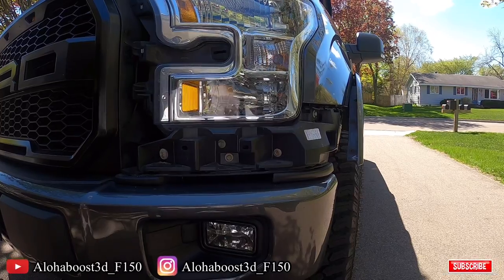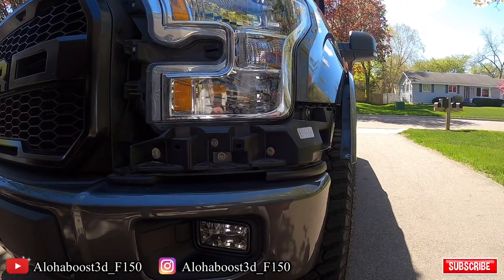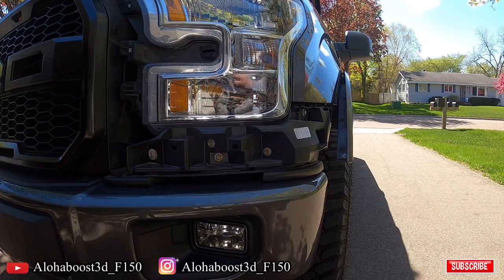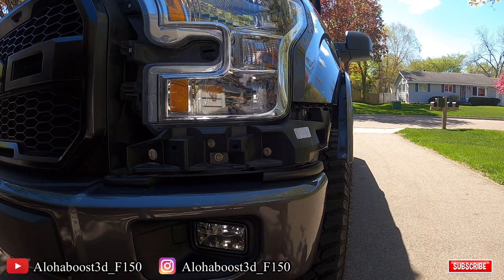All right, for the next step, you're going to have to release the bolts from that lower trim piece that holds in the actual headlight. They consist of six 10mm bolts and one 8mm bolt.